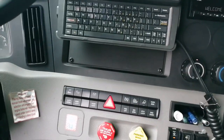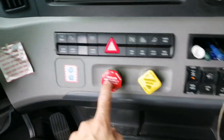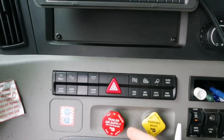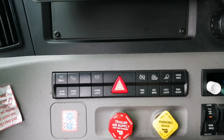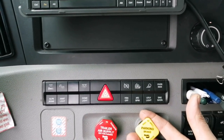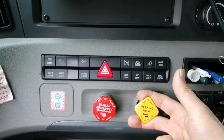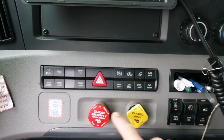On a tractor-trailer — that's what they call this — we have the trailer brake. According to the books, you're not supposed to use this unless you're parked, because it says 'pull to evacuate air supply,' not a parking brake. But the other one is the parking brake. If you pull the yellow one, the red one pops out, which releases the air and locks the brakes, so the tractor and trailer won't move.